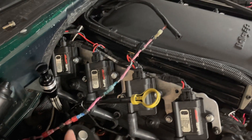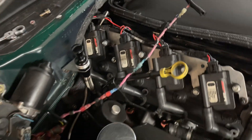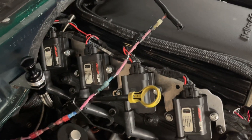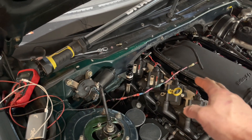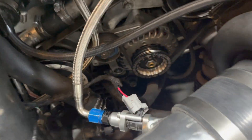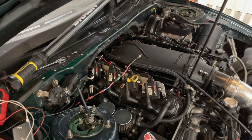I started stringing more diodes together and the amp ratings do make a difference. Right now I have eight of them, ranging between 6 and 15 amp ratings. The lower-rated ones cut more voltage — the 15-amp ones don't cut much, which is why the chain is so long. With eight diodes I'm getting around 16 to 16.4 volts at idle, even with a larger pulley so I don't overspeed the alternator past 8,000 RPM. When you rev it up it's still 16 to 16.5 volts.